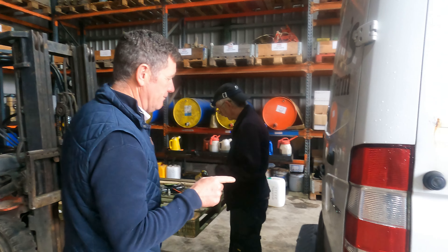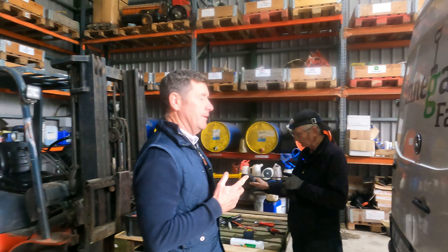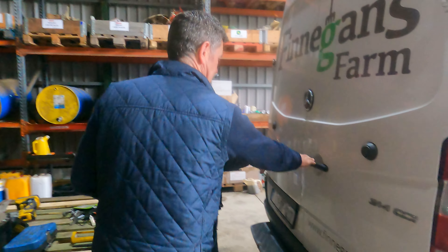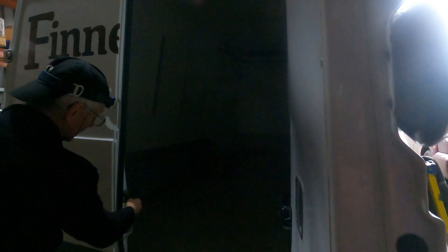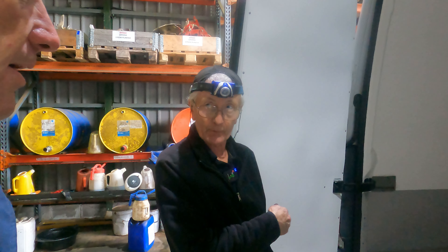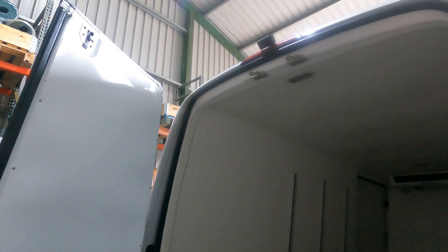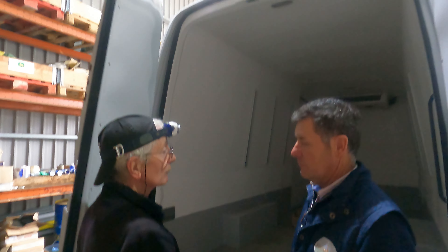We have our Sprinter delivery van. Very important to have a reversing camera or a back camera of some sort on it. As you can see here, we've fitted one on the back of it. Not so easy on something like this, because why you make an insulated panel inside it's very hard to run wire. Normally with the camera it's only for reverse — I like to come off the reverse light. But I cannot get up into here because it's sealed, insulated, and it's rock wool. I had a cable up to the bend but I couldn't get it across.